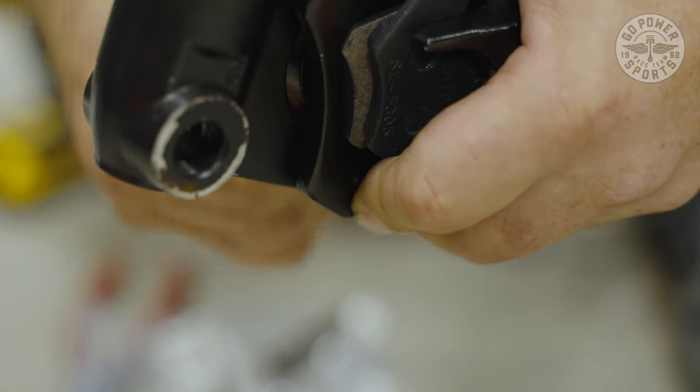You check the tension by first loosening the main bolt. Then we're going to come over here to the locking bolt, loosen it up, and then we can tighten it up. Any turns on this one must be done identically to the other side, to ensure that your tire is straight in the system.